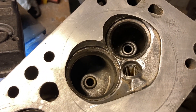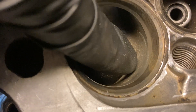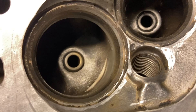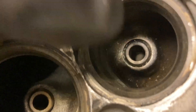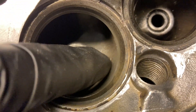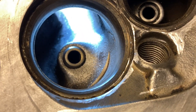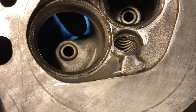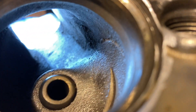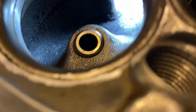I'm working on the 3400 cylinder heads tonight. Not doing any major porting, but I want to clean them up. When the head was machined for the valves, it leaves a lip right at the port opening. All the 3400 heads I've seen have that same mark — some have it on the exhaust side too, but the intake ones all have a significant lip right where the airflow comes in.